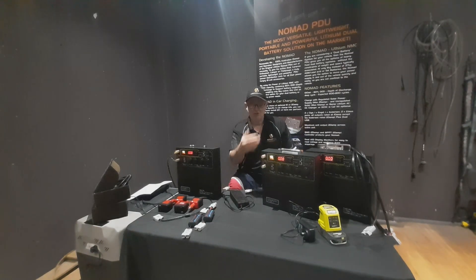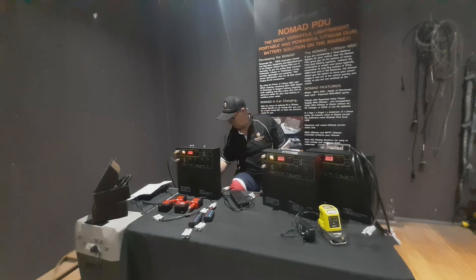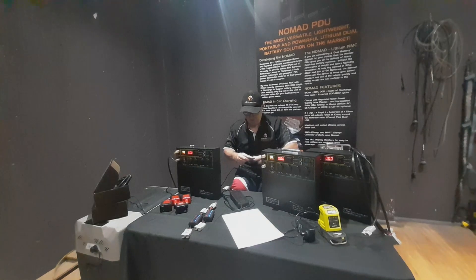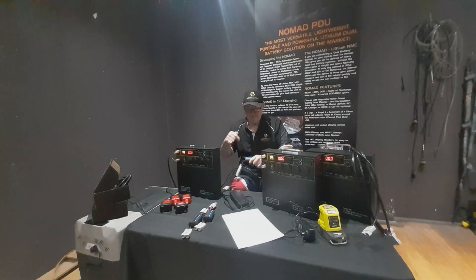That's an 8-amp charger — as it gets close to full it might only put in half an amp, and we'll talk about why that's important to understand in a moment. Diagnostic tools are only about $50 — talk to our partners and most of them will have these. Now if I grab a good charger, this one is perfectly fine, and when I plug it into source it's showing 12.62 to 12.64 — that's the voltage coming out. So I know this charger is fine.